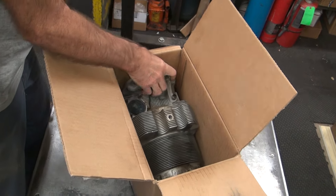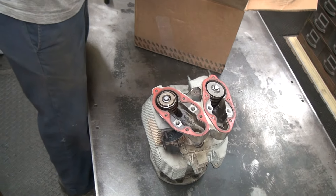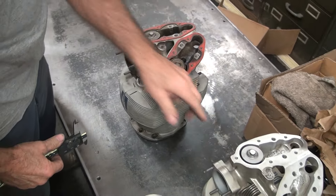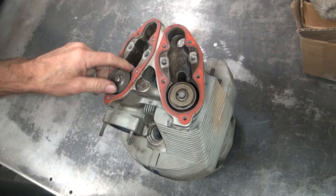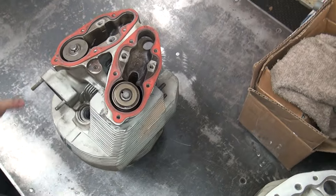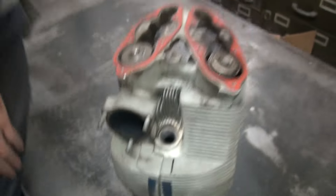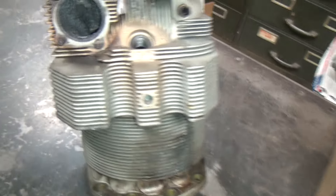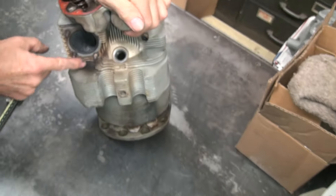These are supposed to be runnable cylinders. It's got gaskets with it — I didn't have gaskets in mine. It's got two different style valves. It's got a rotator on it so it spins — that's probably on the exhaust. This one's a fixed one and that is the intake, even though it looks like an exhaust. See how dark it is — that is the exhaust. It's pretty constipated, barely gets your finger in that thing. And an exhaust leak too.